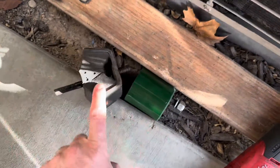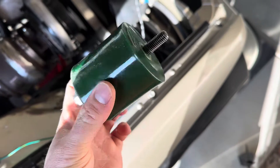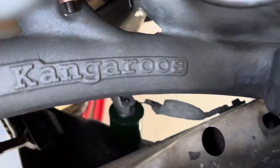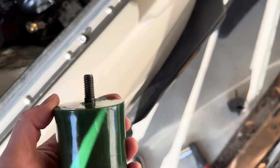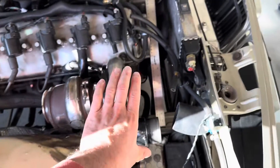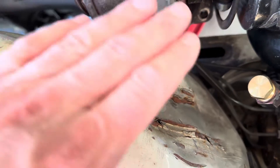Right here - I had a collapsed motor mount. This old engine mount was torn and collapsed. I put in an Ireland Engineering polyurethane motor mount, though the stud is too short - you can see down there it doesn't make it all the way through. But as far as having a motor mount that isn't destroyed and collapsed, using this as our reference for height, we gained about 20 millimeters - about three quarters of an inch - in the motor's angle toward this fender.